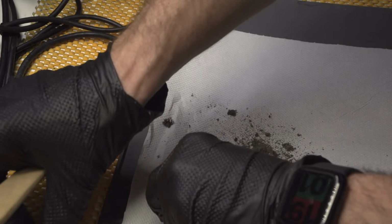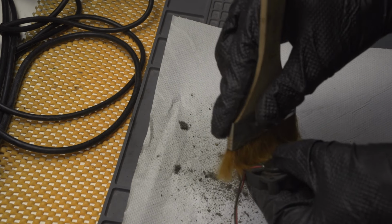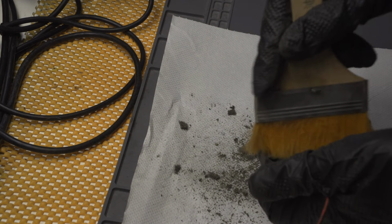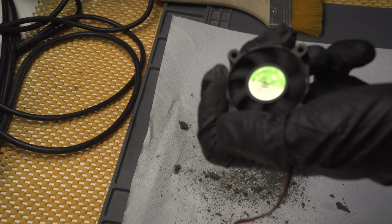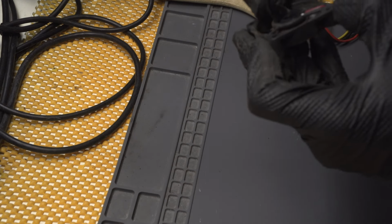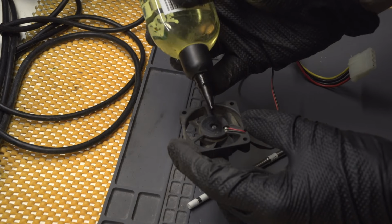Okay. Now the fan. It's not going to be that easy. I mean, it will be to clean. Bearings on this fan tend to fail, and I think that these are one of the first ones that had plastic bearings. I might be wrong, but we'll see. Pentium cooler. Yeah, look at this. But I think that, okay, let me throw this away. But I think that if I remove this thing, yes, I will be able to pour in some oil inside. And this thing just might be okay. I would be so happy if this thing would solve its problems.